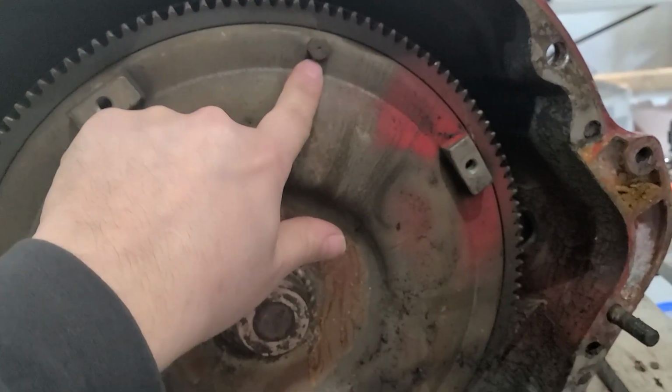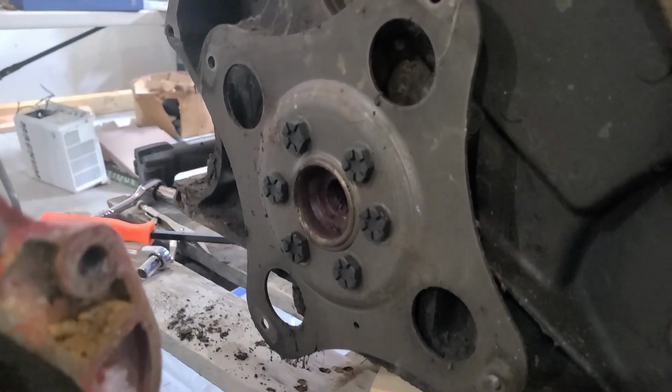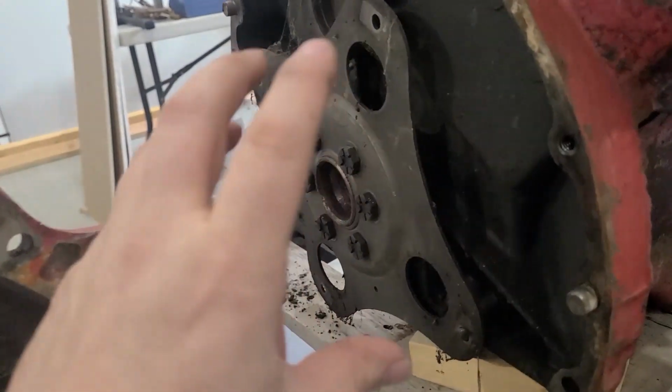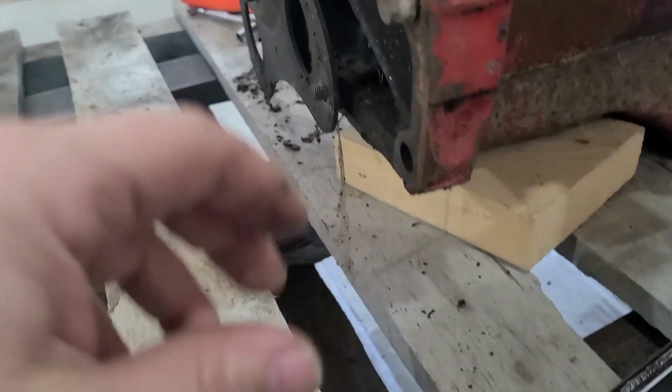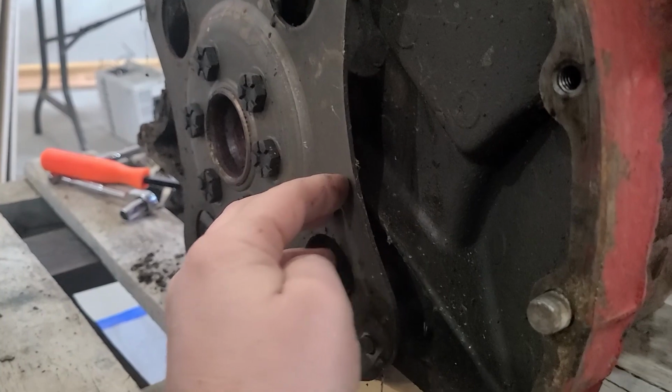That is the drain there for the transmission, for the torque converter. And there was only 4 bolts. And this is the flex plate that was bolted to. Normally your engine would turn over, and with this inspection plate off the bottom, it opens up the bottom side of the transmission here so you can get in and rotate it, take a bolt off, rotate it, take a bolt off. But because this engine's locked solid, I couldn't do that.